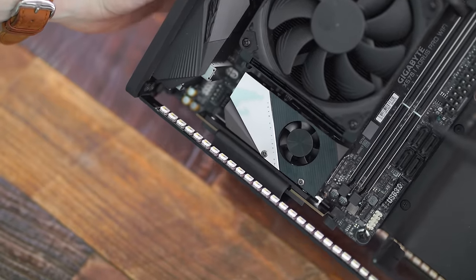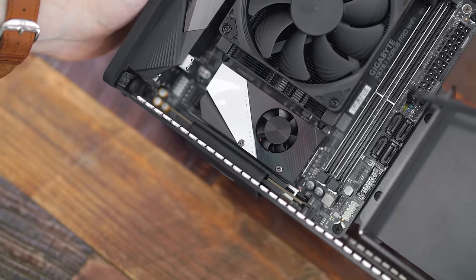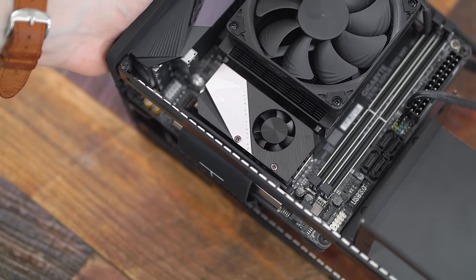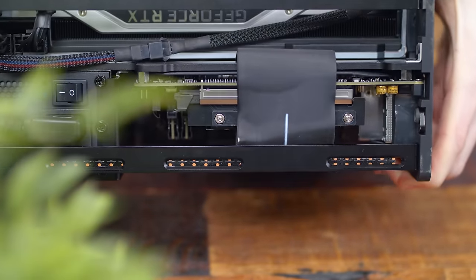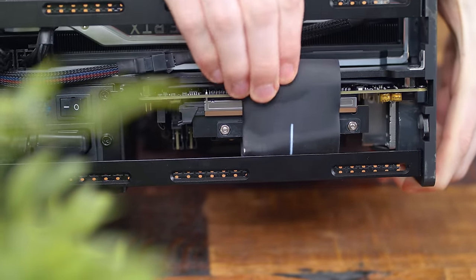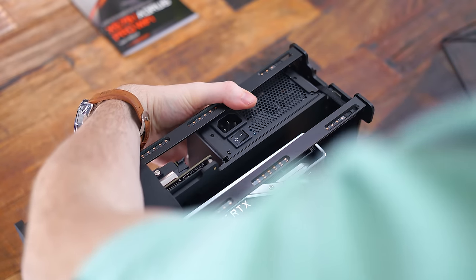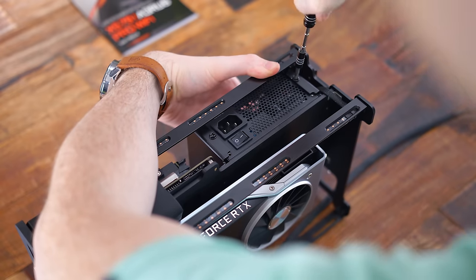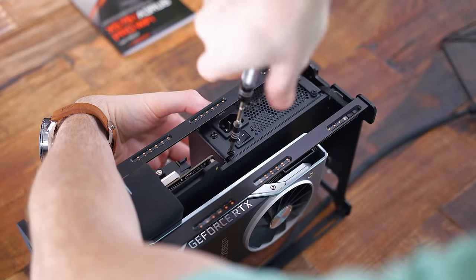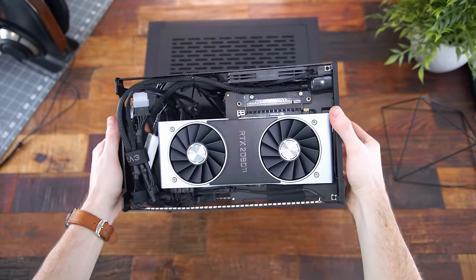Since our GPU is on the opposite side of the motherboard, it connects to the PCIe riser cable that sits underneath the NVMe fan, running under the case entirely. You'll have to bend that riser so it's a flat 90-degree angle and not bowing out of the case. Then wrapping it up, I threw in my RAM — 32 gigs of HyperX Fury — added an additional 120mm Noctua Chromax fan as an additional intake, then locked down the EVGA SFX power supply. And before you know it, you have a beast of a PC in this tiny compact cage.